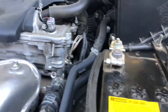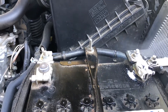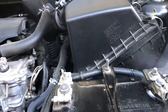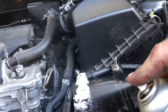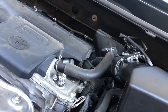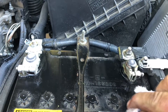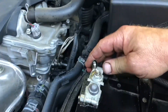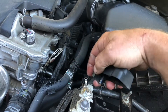They make all kinds of battery products for maintaining your terminals, but you can just take a little light oil — a lot of times that's all you need. Give it just a little spritz. I don't see any corrosion building up on the battery or around my terminals. Everything looks tight. Let's get the cover back on.